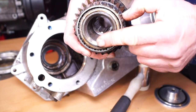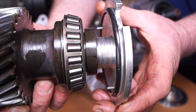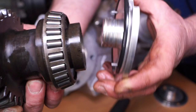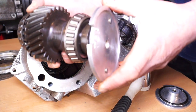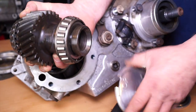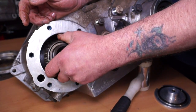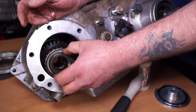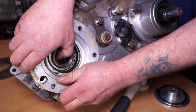Oil gunge does collect in this area here. The feed plate, by this screw, introduces oil into the splined area — not massive amounts of it. This is a solution thought up by Land Rover before they introduced cross drillings into the input gear, which also means you can actually retrofit this to transfer boxes if you do not have a cross drilled gear.